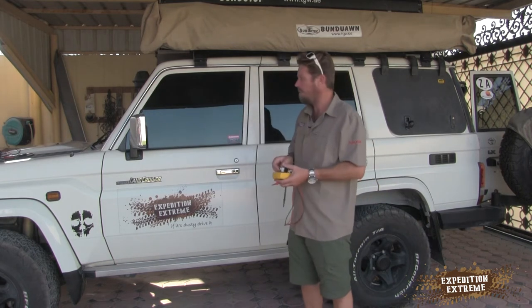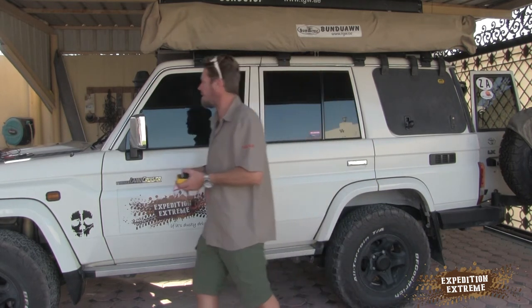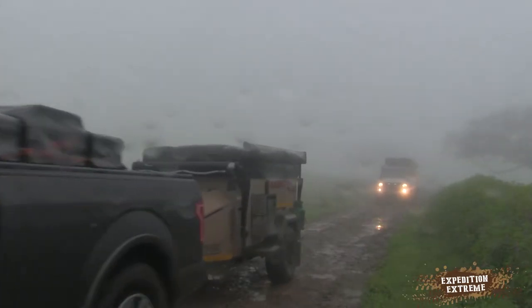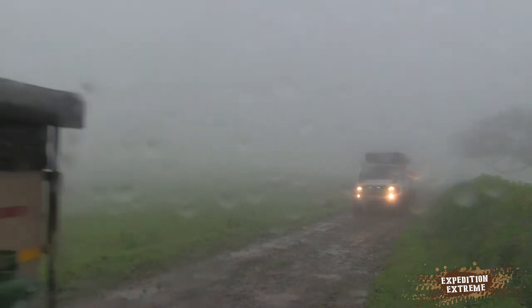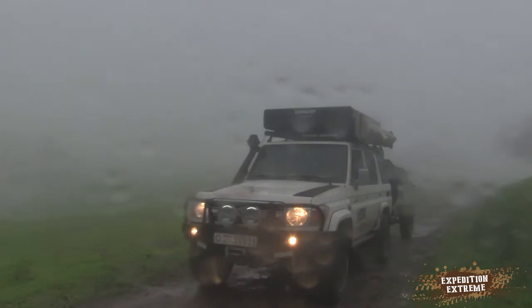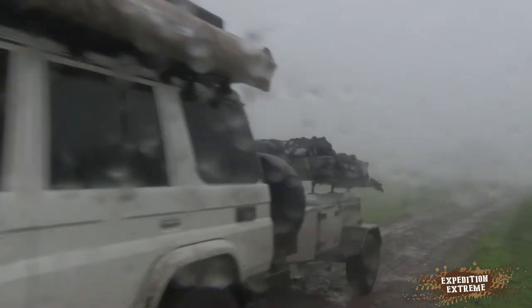So now you're at an issue where, well, I know why my batteries have failed. While we were down in Salalah, we spent 5 or 6 days with virtually no sun, overcast weather, which means that my solar panels were not giving enough charge into my batteries to fill them up sufficiently for the overnight usage of the fridges.